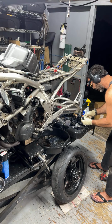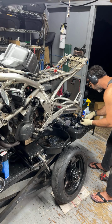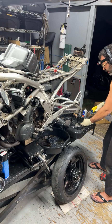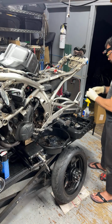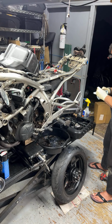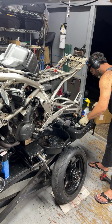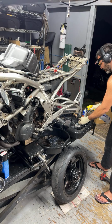You do want to put some grease on the spacers to where they touch the seal. But other than that, maybe just a little bit extra for maybe corrosion protection. It's okay, but if you put too much, usually it ends up just kind of slinging all over the place and attracting dirt, turning into like a grease sludge. So not too much. The trick is doing it consistently, which is the difference between something that lasts and something that typically doesn't nowadays.